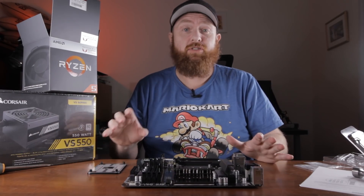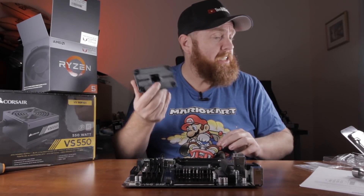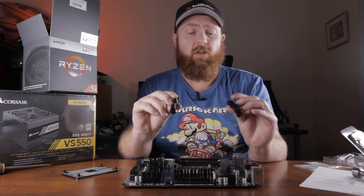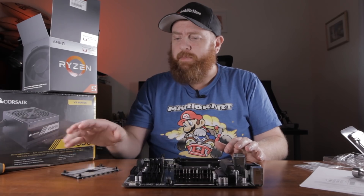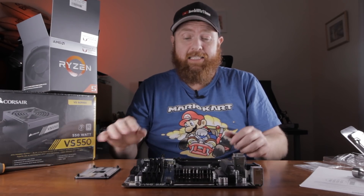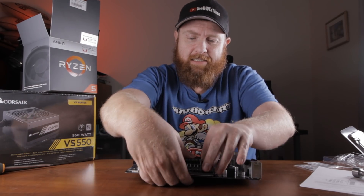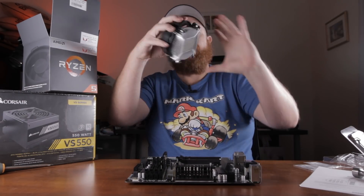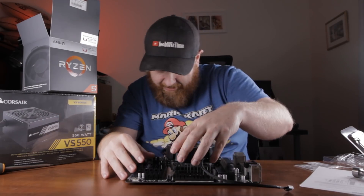This is a massive case of read the instructions before you go forth. This base plate that goes underneath for the CPU to attach to the cooler — on the motherboard there were these two little offsets that you need to detach for the 2400G cooler. I didn't think about that. Had it all in the case, dismantled that bit off the board, and then the back plate dropped off. So that's why I've got to do it now. Like that — okay, so now it actually works.